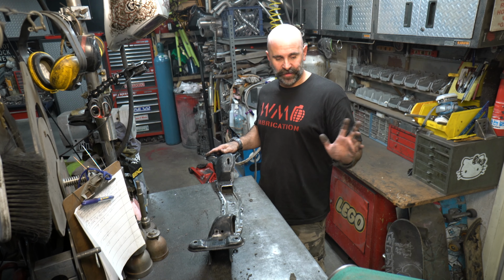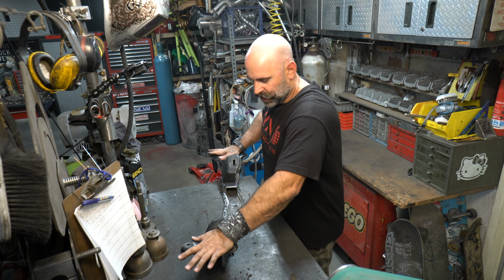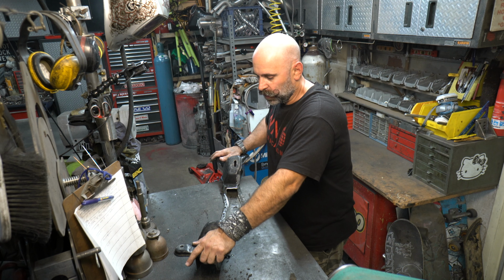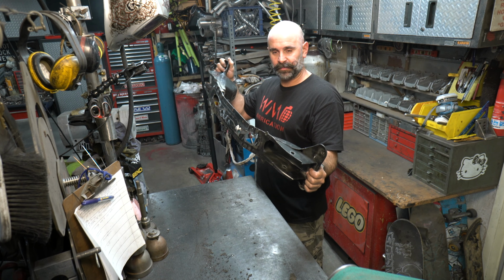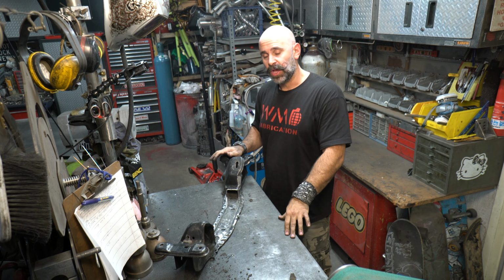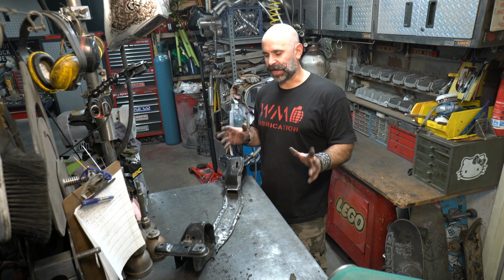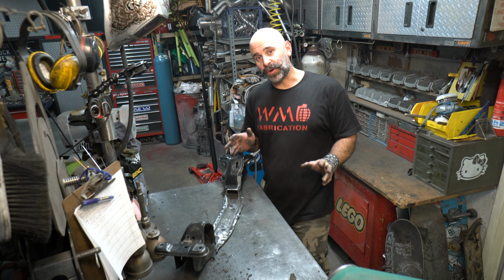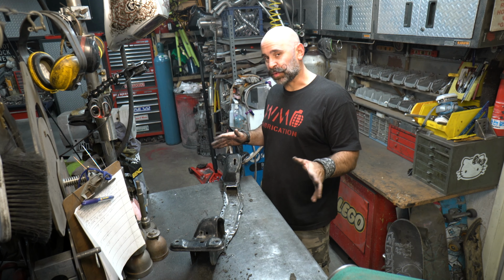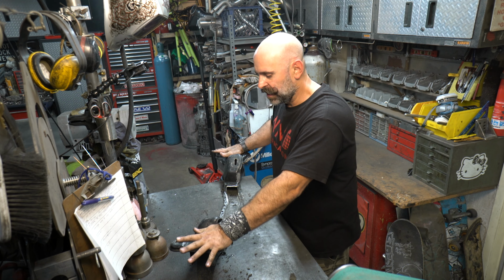Now, I have a subframe brace that I'll be using, but if you don't, make sure to clamp it down to your work area. Look, I could twist it and flex it. There's not a lot of material left, so you don't want to warp this thing. This is where your front lower control arm pickup points go. So it's very important to make sure this thing doesn't taco up on you. Since we're tacoing about it, you can clamp this thing to your work area.